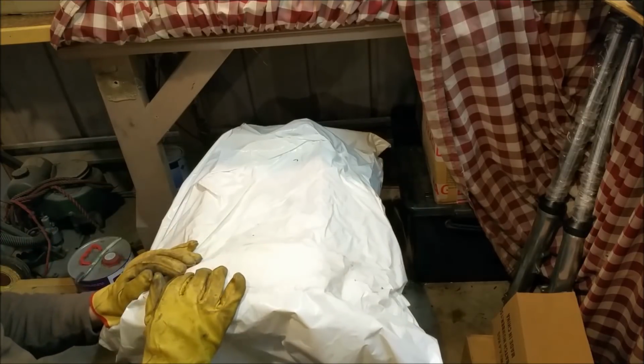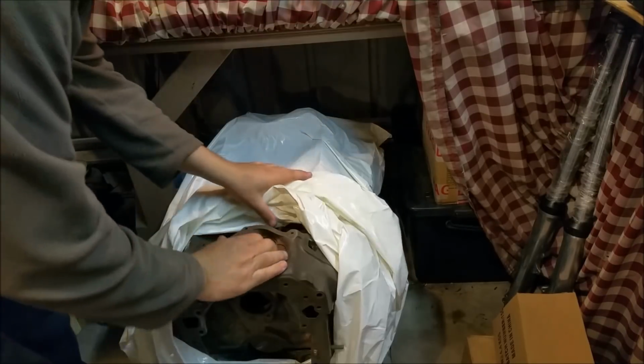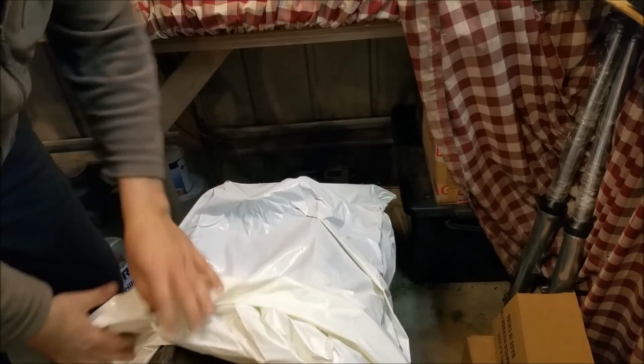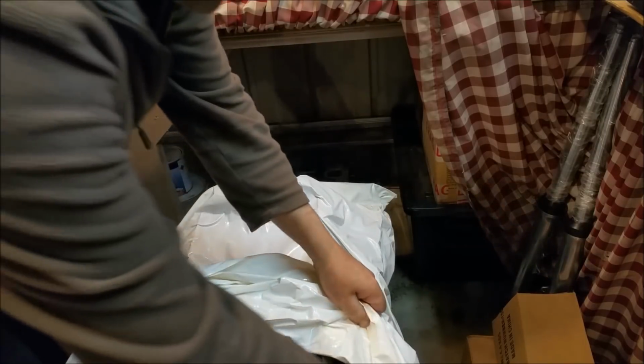What was I going to say? Oh yeah, I did the Junkyard 302, and it turned out the block had a few little cracks and stuff like that in it. This one was another block I got through Speedworks in Ringwood. But the main draw card with this thing is it's already been bored. It was a virgin block and we bought it 20 over.